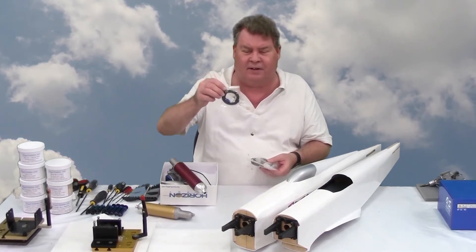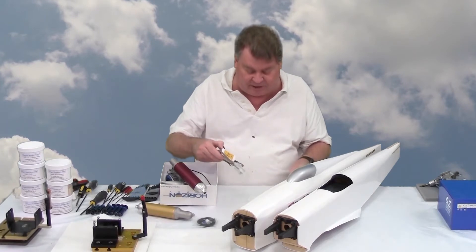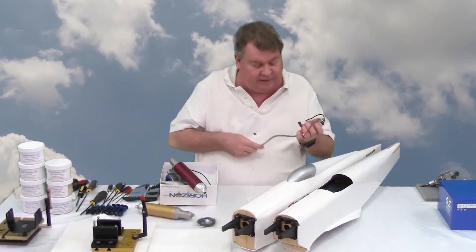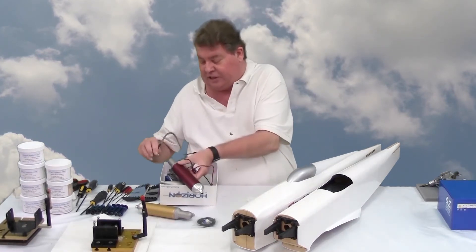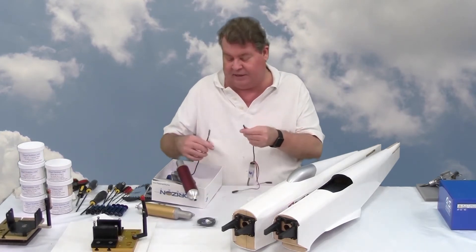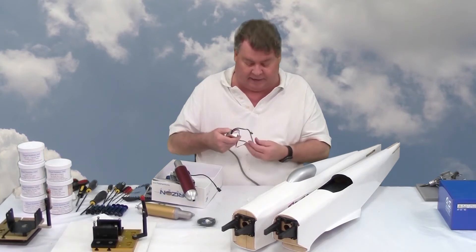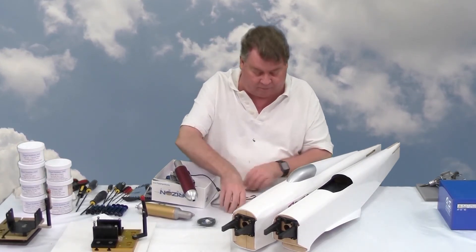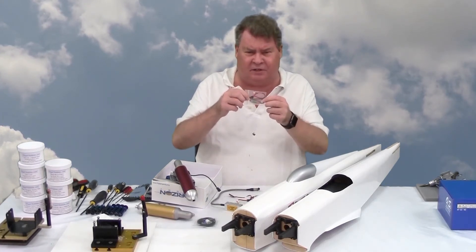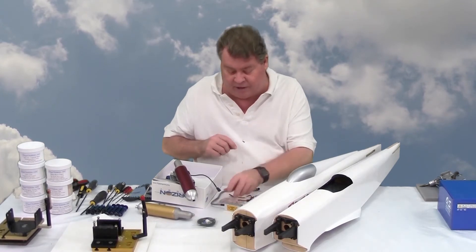It comes with a clunk and fuel line made for gasoline — you can't use a stopper designed for nitro in a gasoline fuel system. This is the ignition box; it just snaps onto the spark plug and has a lead to go to the timing sensor, a tachometer out, and a power connector. They also include a spectrum telemetry sensor, and you can use these telemetry sensors with other ignition boxes, so if you want to get in-air RPM information, you can do so pretty easily.